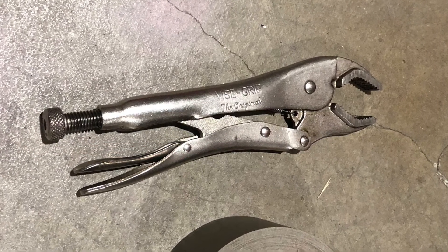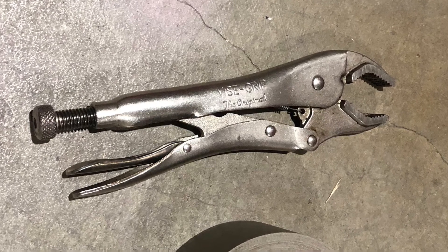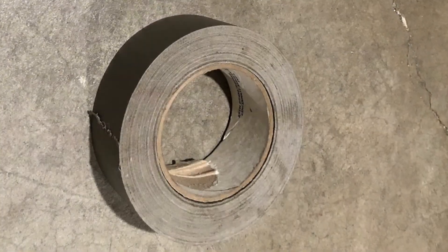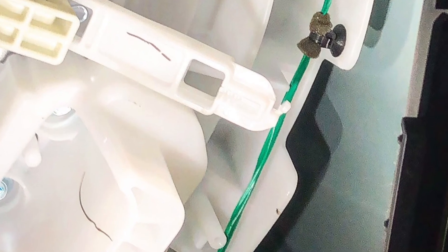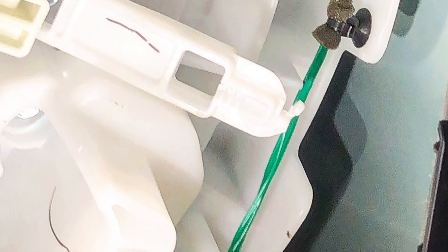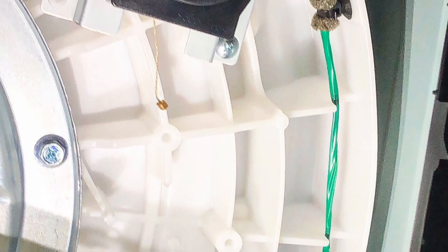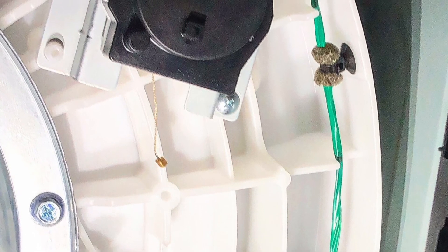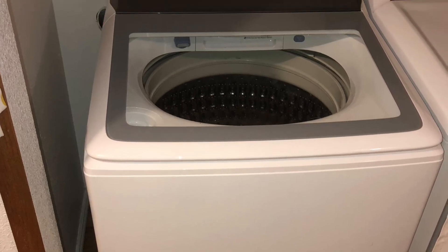The final repair was done with a piece of duct tape. I hope this was helpful to anybody whose washer machine is not draining or rinsing — because if it won't drain, it won't initiate the rinse either. It'll go through all the other cycles, but when it comes to drain and rinse, it won't do that unless you either connect the drain link or buy a new one and put it on there. Hope this was helpful — peace.